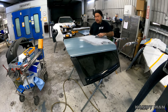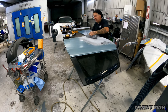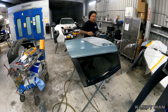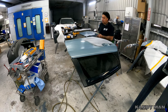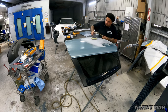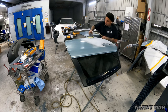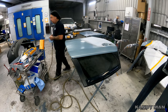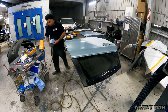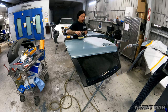So we got this blocked. We'll blow it off and I'll show you how I hit it with my DA. I went ahead and blew off the panel, re-guide-coated it, and now I'm going to hit it with my 400. Then I'll hit it with 600. Throw your paper right into the can when you're done with it — that way you don't make a mess. We'll go over this with 600.